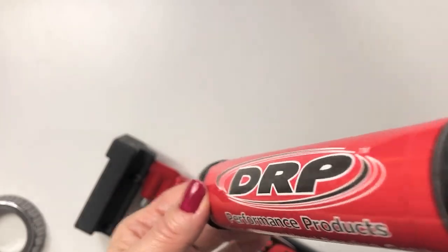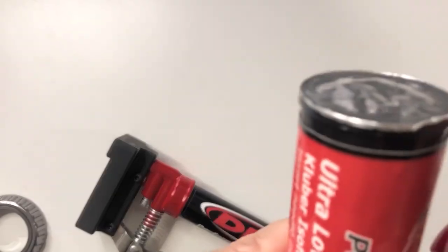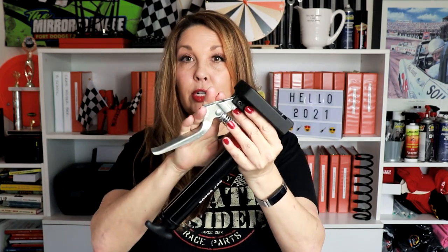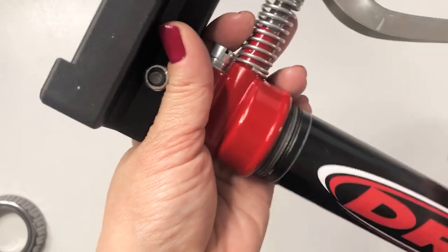So let's go ahead and try this out. I'm really excited because we're going to try this out with this mini canister right here — this is going to be a little bit of an adventure. I can see that on one end it has a cap, and on the other end it has this aluminum foil type of thing. So the first thing we're going to do: this is two pieces — we have the gun portion right here and then the cylinder down below. The first step is to unscrew the cylinder from the gun portion. Before we can put the grease in, we definitely want to pull back on this plunger so it doesn't interfere with what we're doing.